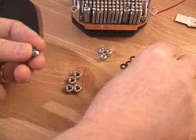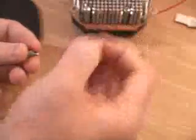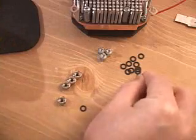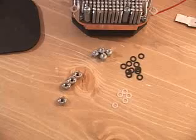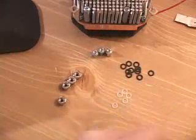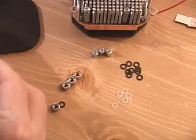Then at the bottom of the motherboard, you're going to need a fiber washer and a hex lock nut. I'm going to show you this in action a little later on. Now, if your motherboard has small non-grounded holes, you just use the standoff and the fiber washer through the top, and again at the bottom, the fiber washer and the lock nut.